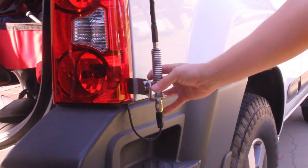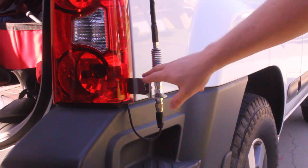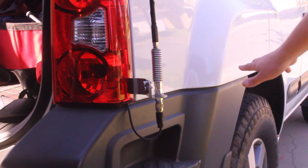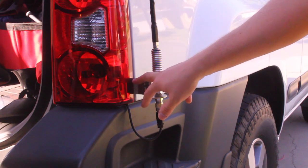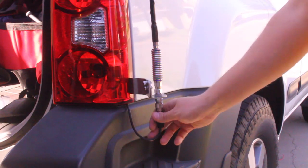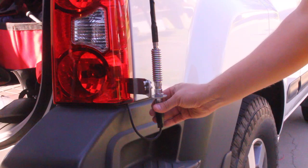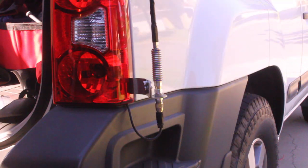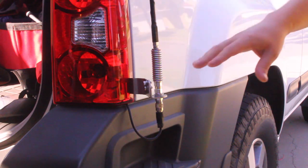Basically, it's a real firm antenna with very little flexibility. I've added a fire stick spring and I'm using the fire stick mount. This is an adjustable mount with 180-degree rotation depending on your configuration. I have it behind the tail light. I had to put a small bend — I actually need to add another bend — but it's very simple. You just drill a pilot hole or use a center punch, punch a hole, drill into the body behind the tail light, mount it securely. And I have the 18-foot coax cable here.